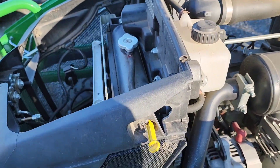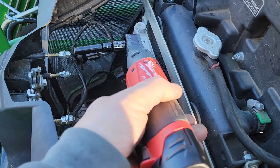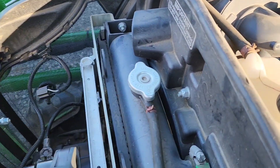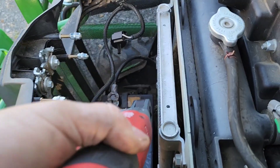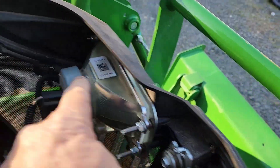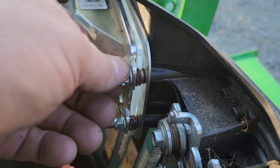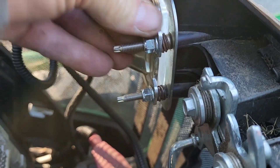Having the right tools is huge. Just having power tools is a big advantage. When putting it back together, make sure you get the tabs on the light assembly behind these little plastic molded things — otherwise you can do it wrong. Also, don't tighten the bolts all the way down; the springs are there so the assembly has a little give and vibration resistance.